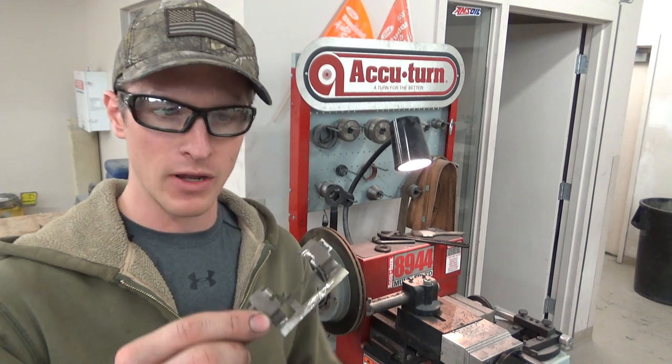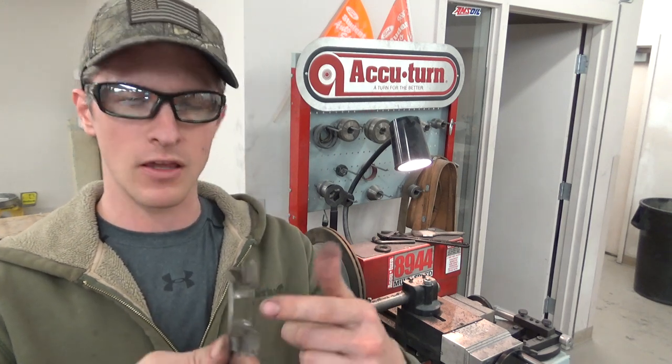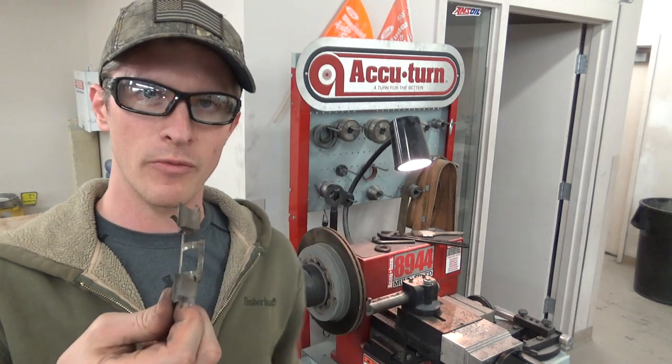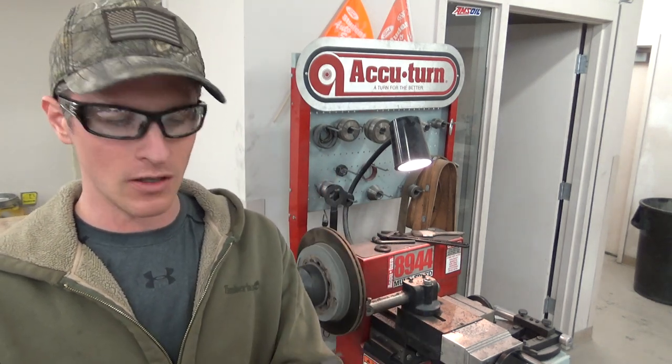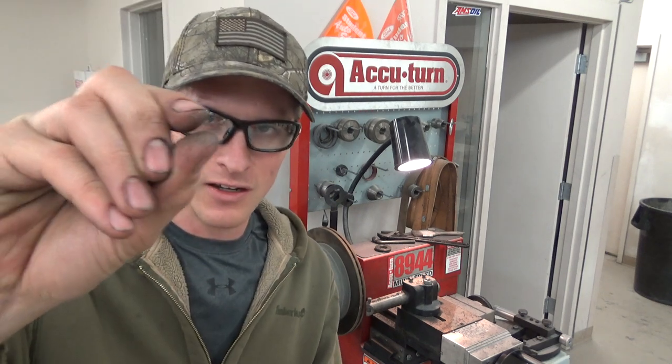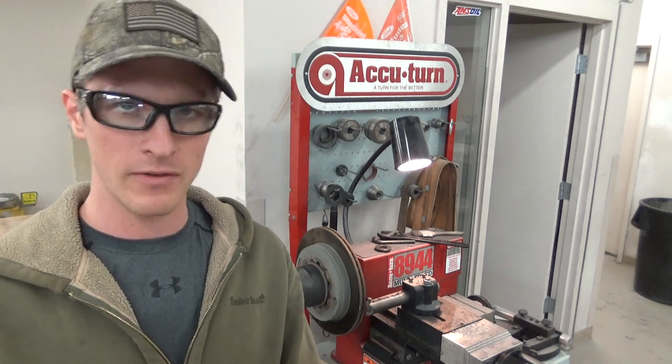Kind of got to point a few fingers here. But what was happening is, this is the old abutment hardware, because I didn't grab the camera when I fixed the vehicle. I mean, it's all good now. But the edge of the disc was rubbing on the abutment hardware. So I thought, well, can we tweak the hardware? And it was like not even a millimeter between the abutment hardware and the edge of the disc.